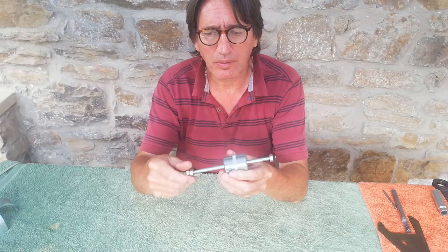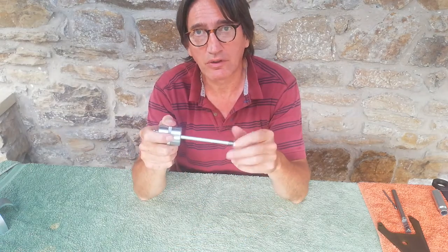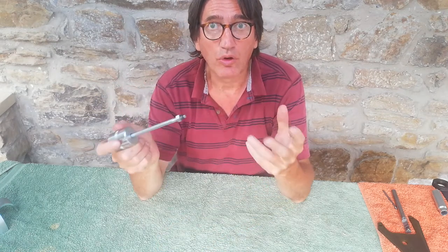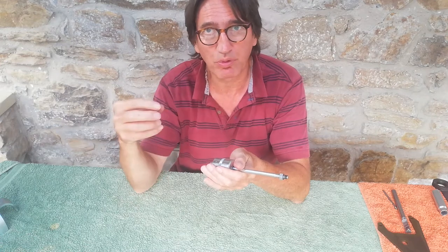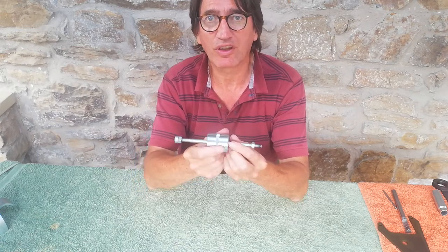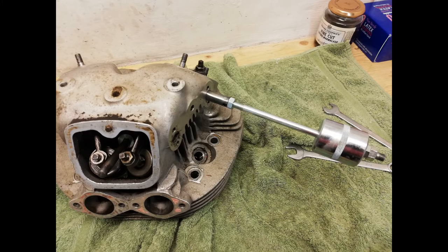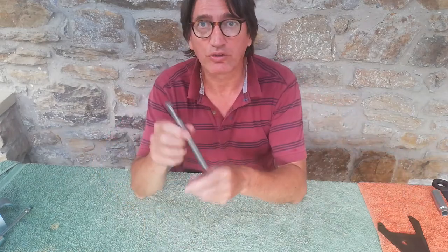This is mainly used for removing the rocker shaft out of the cylinder head on the Commando. The rocker shafts are a very tight interference fit — they're hammered into the head when it's very hot. But even heating up the head, there's no way to pull them back out again. This end screws into the rocker shaft and then you use it as a slide hammer, literally smashing it back until it pulls the rocker shafts out.